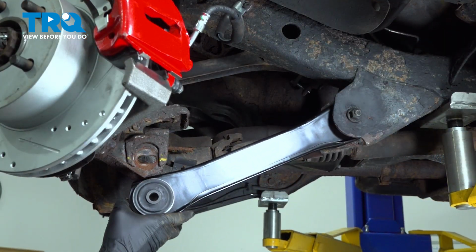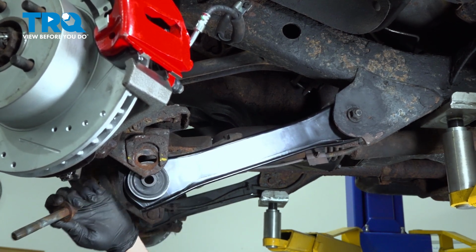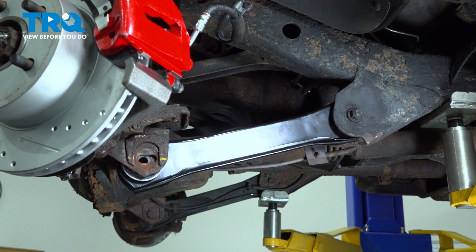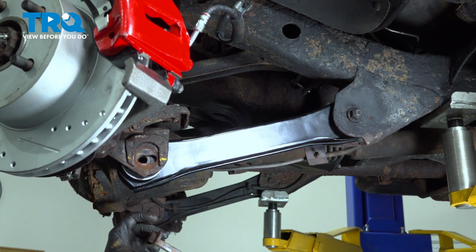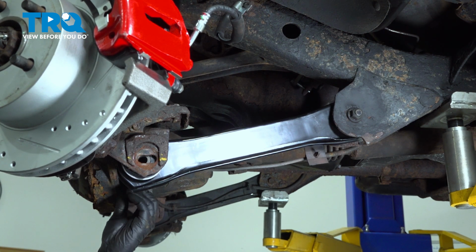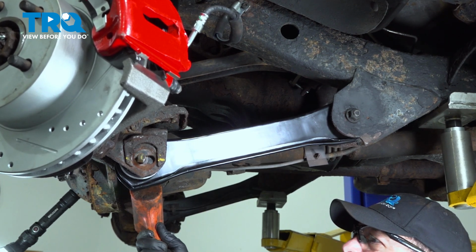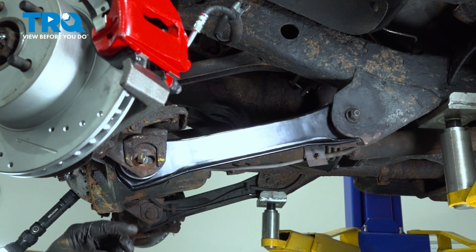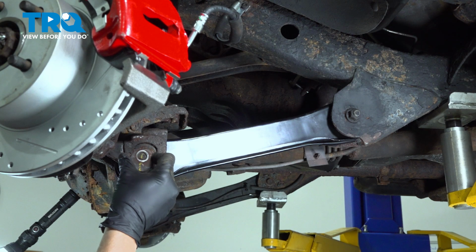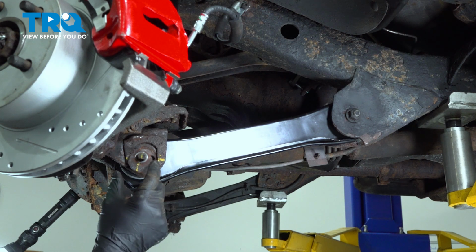Go ahead and bring the control arm up. And you're probably going to want to use a mallet or something like that to tap this up and in. Put our bolt and cam through on the inside. Now with the bolt coming through, take your cam. That'll only go on one way. We're going to go ahead and put the side that we marked obviously on the outside.